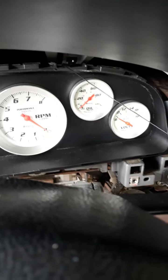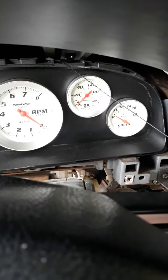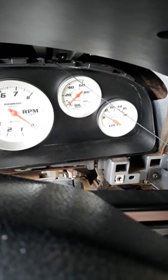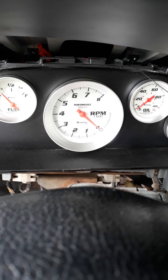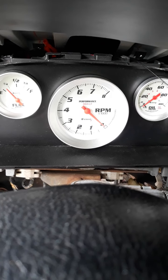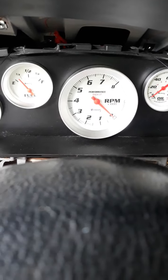Right now this is working and I'd like to make a video on how I wired everything up, but it's basically straightforward — you just wire everything up to the factory harness behind the dash. Most Nissan Hardbodies, even if they don't have a tach, will still have the wire harness for the tach. You just figure out which wires go to the distributor for the tach, connect them, and it'll work.